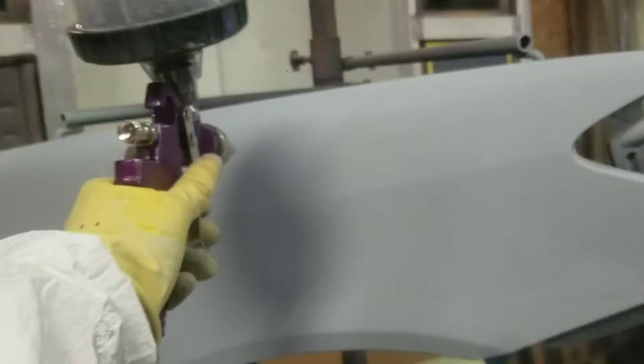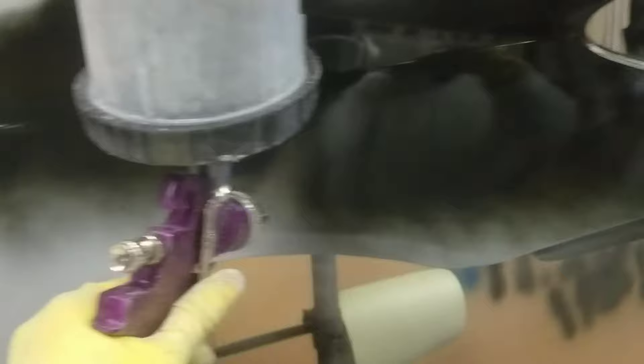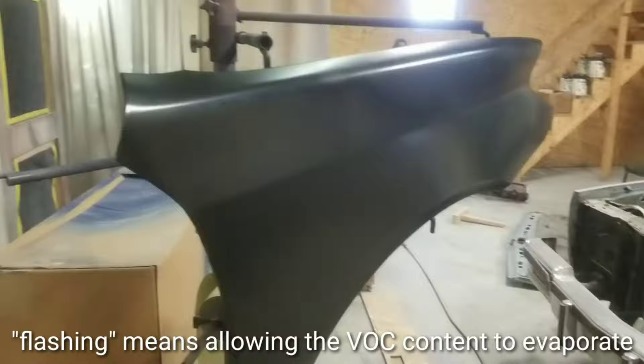Let's shoot — I'll try to get you a shot of me painting one-handed. The base coat — coats one and two — are shot. You can see it's still flashing; there are little shiny spots, but once it dries it'll look dull just like this area here. Once it has flashed I'm going to take a couple hour break and come back and lay on the clear coat.